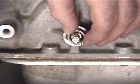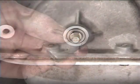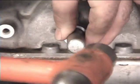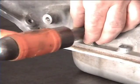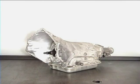Install the new seal, working it around the shaft, taking care not to damage the rubber part of the seal. Now, using the installation side of this tool, set the seal into the case. Then reinstall any park linkage. And that's it! You're finished!